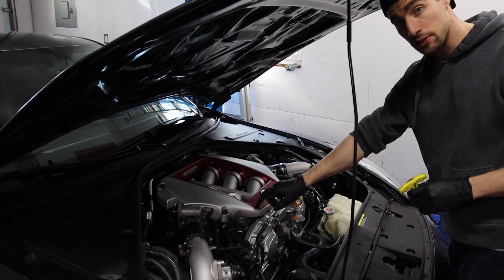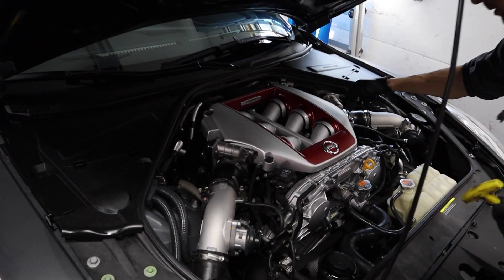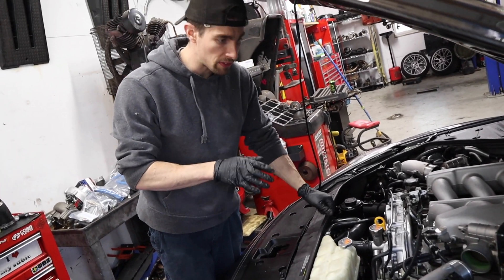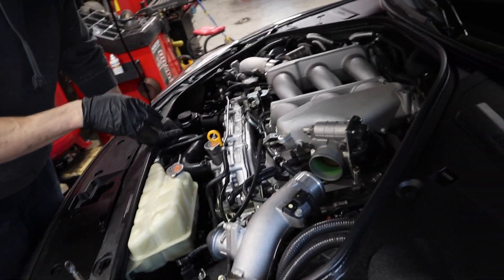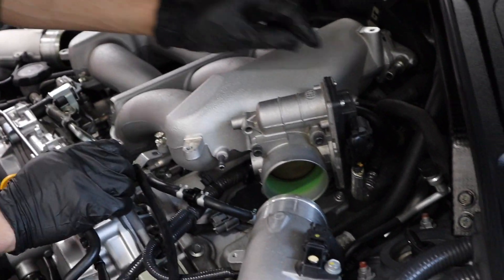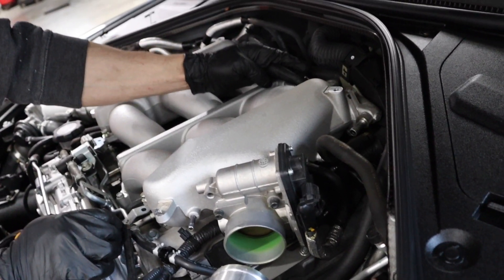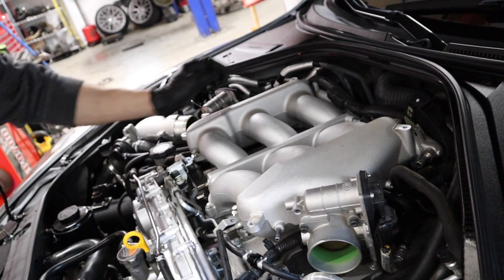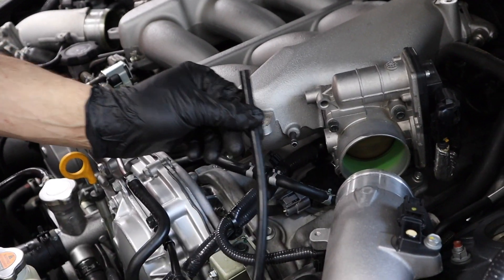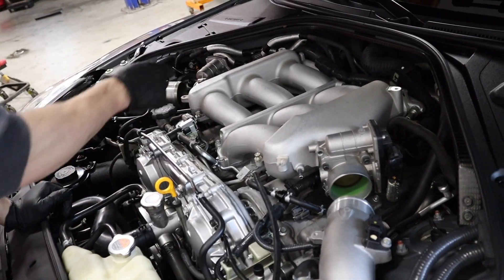First piece, we're just going to take off this plastic engine cover — five millimeter Allen and four bolts. So a quick rundown: we spent about five minutes just disconnecting a couple of hoses. We got the couplers off for the throttle bodies on both sides. There's a brake booster line back there, another line right up here, a wiring connector, two 10 millimeter bolts, and vacuum lines. So anything you see directly to the manifold — that's some quick and easy stuff.